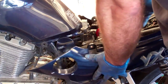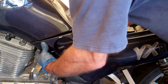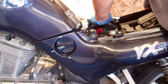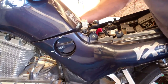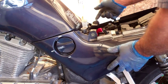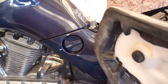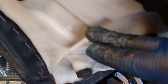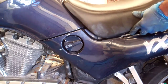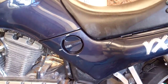Going to snap our fairings back into place here, and over here on the right side of the bike. Then put our Phillips head screws in there. Now going to take the front of the seat — the hook that's there — slide that into place like so, push it down at the back, and you probably heard that click into place.